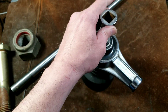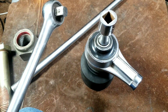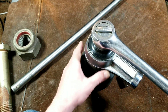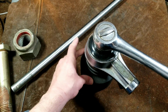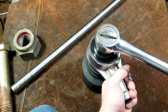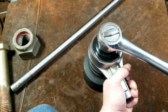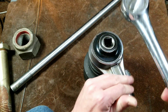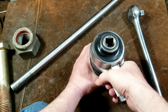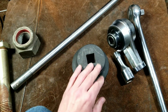Once you've got the fastener broken, you can use just a regular 3/4-inch drive ratchet dropped in there. You can see it still wobbles around even with the ratchet itself, then just ratchet out the fastener. As soon as you get a little bit of tension off, you can see how little that socket is turning. Once tension is off, you would remove the multiplier — which has a really strong ball detent — and then just use a normal ratchet against the socket to ratchet out at a normal pace.